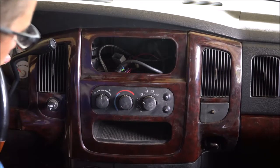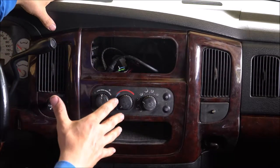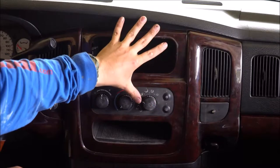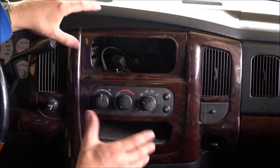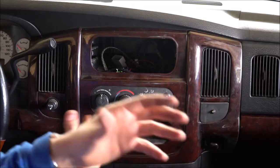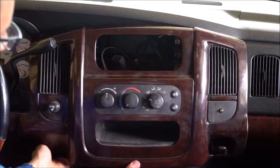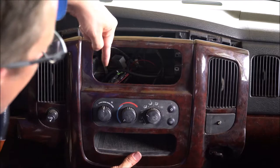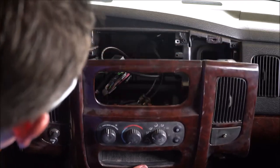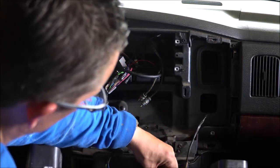Okay, so here we are in the truck. Basically what we're going to do is — you see here I have an empty hole. Now if you don't have an empty hole and you actually have the radio, it's going to be the same thing, just an extra step. This car did not come with the radio when we got it. So we are going to take this out and see what we need to do here. If you want to use your pry tool, you can — you're going to lift on the bottom left side like that, and this is all going to come out. You are going to have wires attached here to your air conditioner, your cigarette lighter, and that's it.